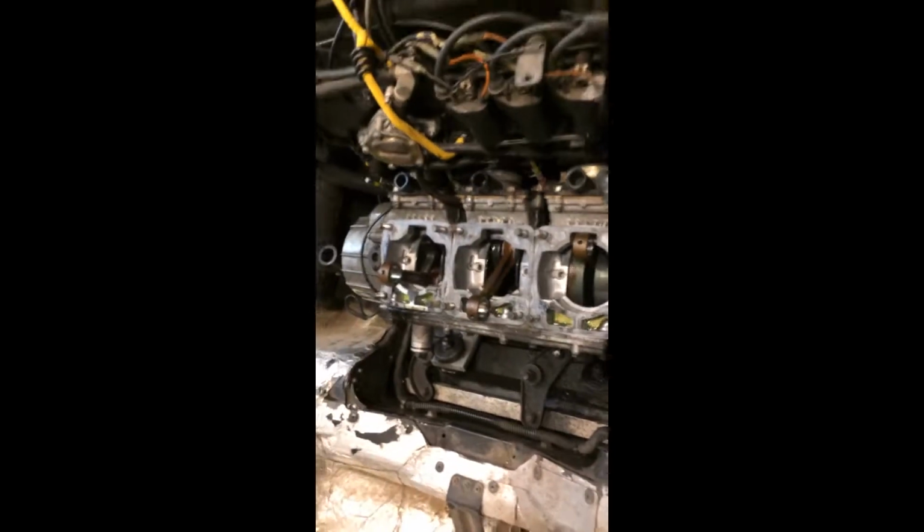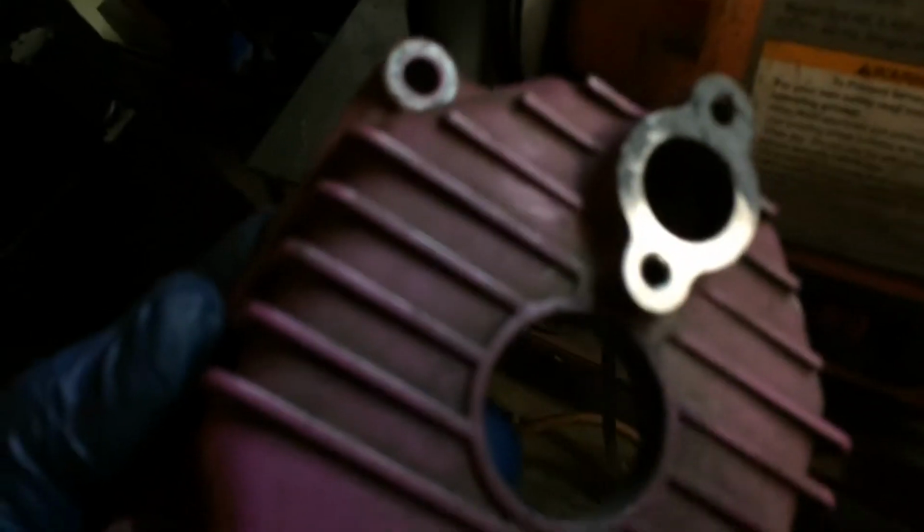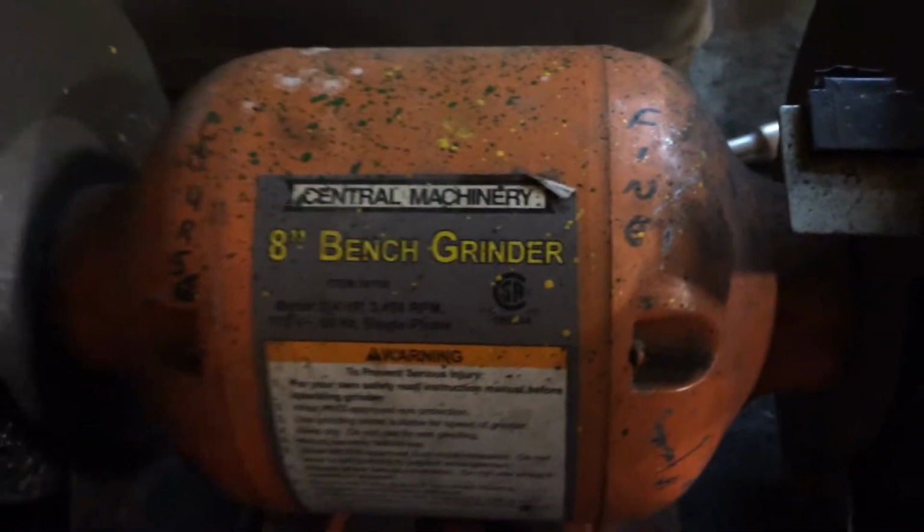He didn't like also the way I tore the gasket already, but I didn't like the way it just didn't stick right there at all. It's like I didn't get enough sealant on it or something is askew. When I put this together, I'm going to use lots of sealant. A wire wheel on your bench grinder makes quick work of these gaskets. Works well on the coolant pipe, the little coolant pipe that goes on the head. Works really well.